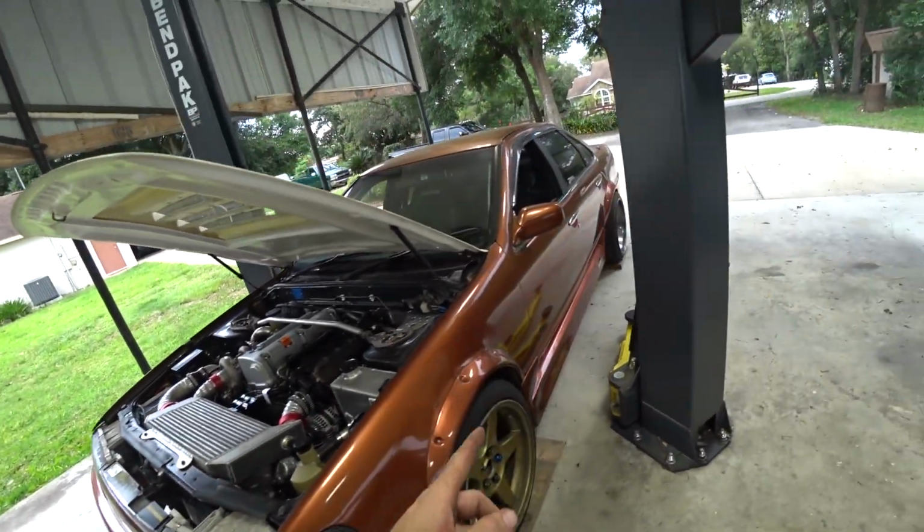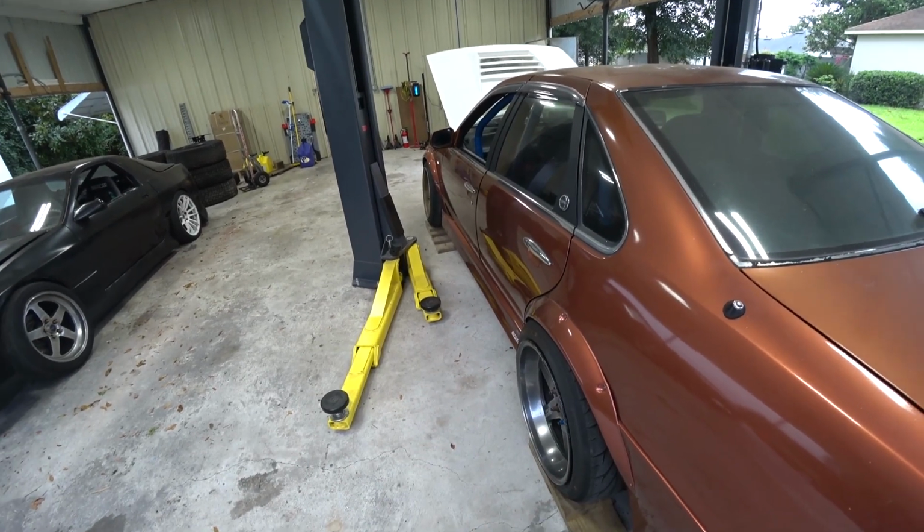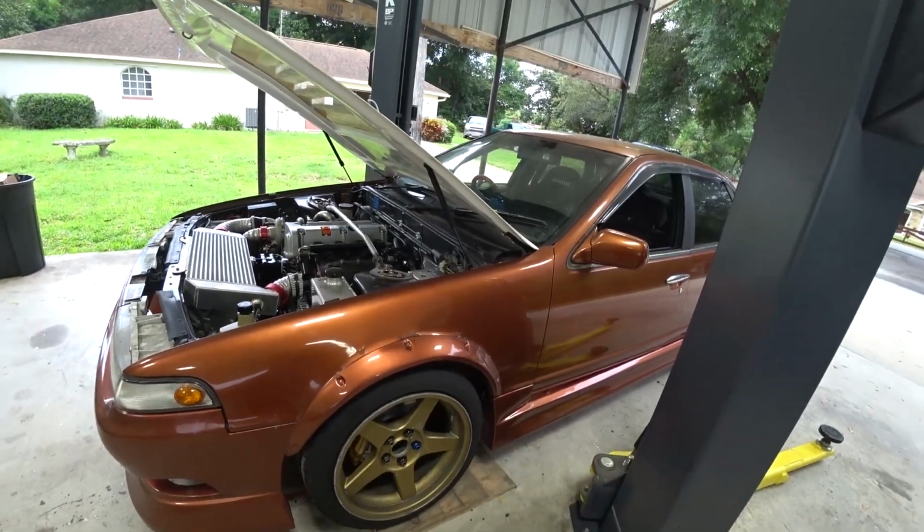All right, well, the rear was pretty much in spec. We need to go through and properly set up the rear suspension, so I just wanted to make sure it had little to no toe. It's got a 1/16 of an inch toe in, and we've got about a 1/16 of an inch out in the front now. So I'm good with that.